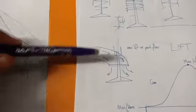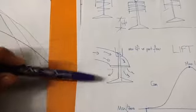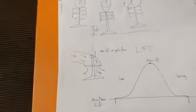So I've got the arrows, basically our fuel and air mixture coming in. As the valve lifts, we open the valve and promote fuel and airflow into the cylinder. You can see here, the more lift we have, the bigger this opening, and the more air and fuel we can flow into the cylinder, and in turn have more fuel and air to burn, and hence make more power. So typically, more lift the better, because it is going to open the valve longer.